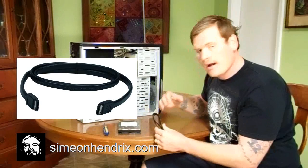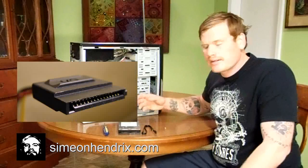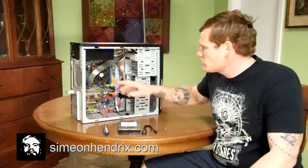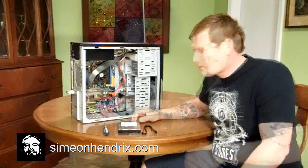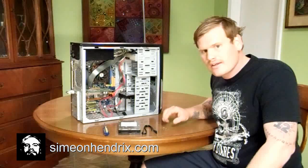Tools that you're going to need: a Phillips screwdriver, the second hard drive which you're going to be installing, and a data connector cable. In our case, this hard drive is a SATA hard drive, so we have a SATA data connector. You're also going to need a power connector cable running out of the power supply already in your desktop PC. Before you start, double check that you've got enough power from the supply to power your hard drive — in our case I've got an extra 15-pin SATA power connector. You'll also need two small screws to secure the hard drive to the shelving.